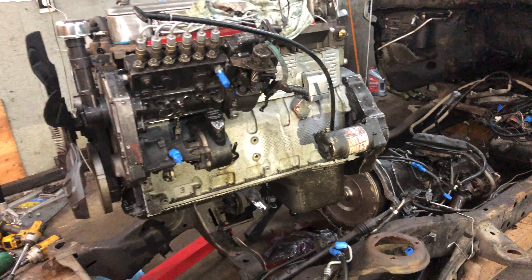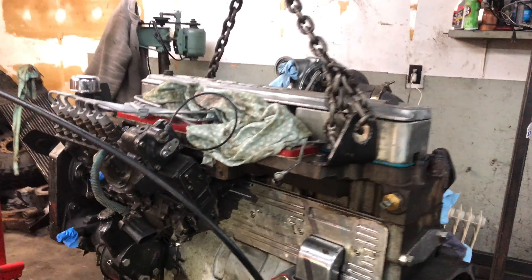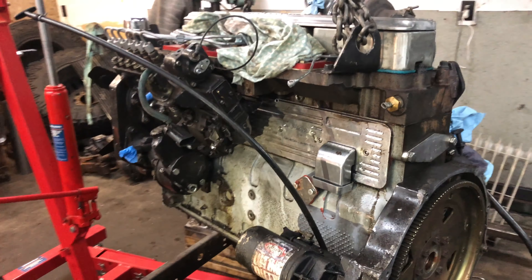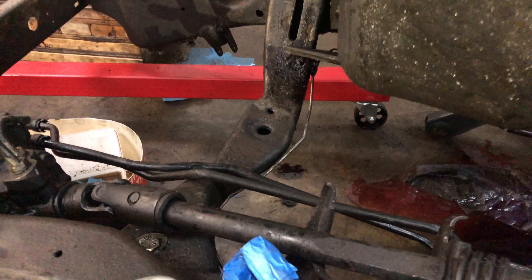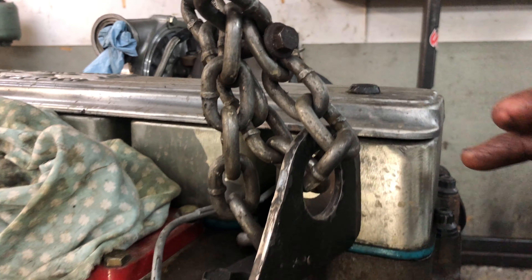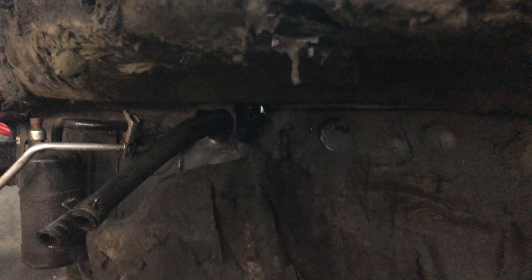It's nice to see that thing floating in the air — that is a 12-valve Cummins sitting there, 100% intact. This is not something you see very often unless the cab's removed. When I had this engine out previously, the only way you could get it out was to remove the oil pan because it sits very close to that crossmember. Then you'd pull the cover, the two rocker covers, and maybe the rocker pedestals because both of those sit underneath the firewall or the cowl.